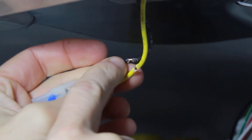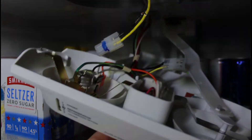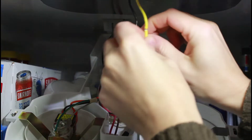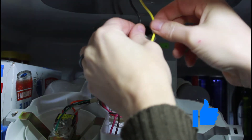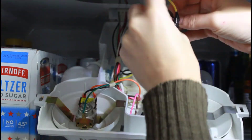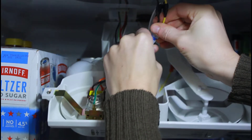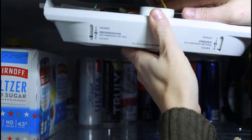I was able to strip the wires right in the middle — the right tool for the job. Next I'm going to feed the switch up through the hole in the bottom and connect these wires to that. There's our spliced connection. I'm going to put some electrical tape on this and then reconnect it. We have everything wrapped nice and securely with electrical tape — those new connections aren't going anywhere. We can reconnect the switch and lift everything back into place.